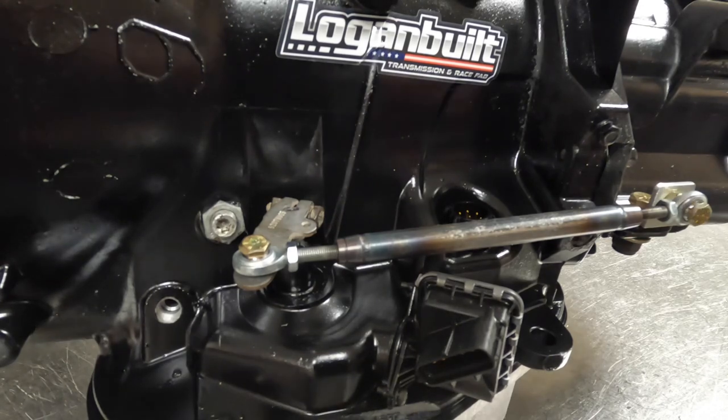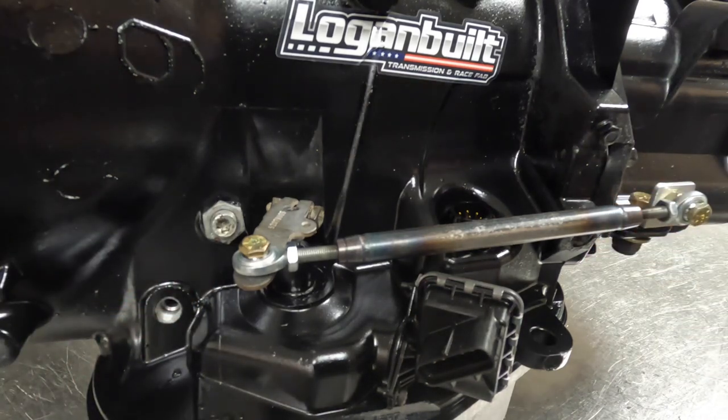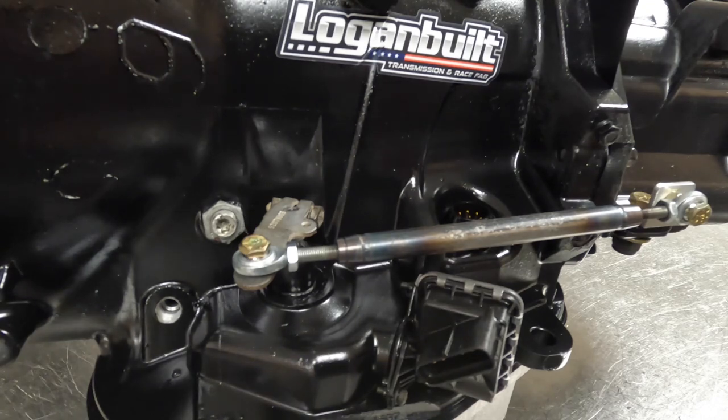Really handy tool. If you shorten it too much and go too far, you'll have a bind — that will feel like the truck is nosing over on the 2-3 shift, almost like hitting the brakes. You can just lengthen the adjuster to take some of that bind out and get it timed in perfectly. In a racing application where you have data, you'll see in the engine RPM: if it's a nice peak and fall, that's a perfect 2-3 shift drop. If it's rolled over before it falls off, you have a bind. If the RPM jumps up before it falls down, that's a flare. Data is really helpful with timing this in a racing application.